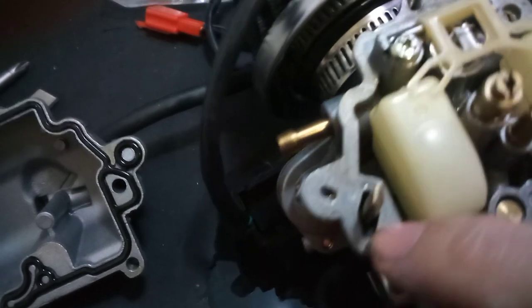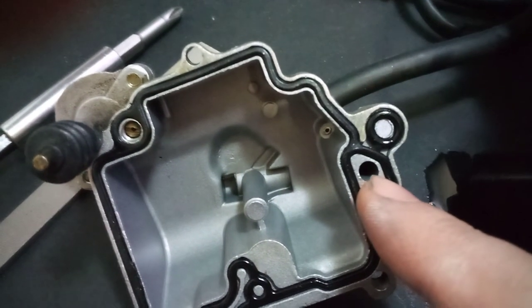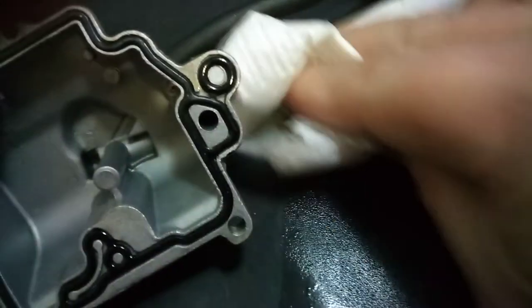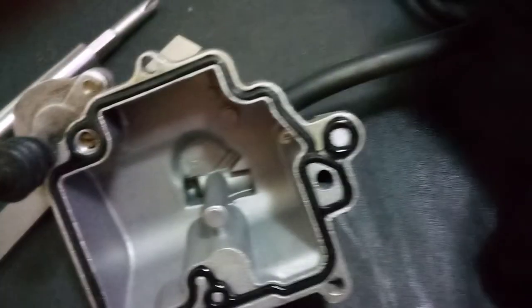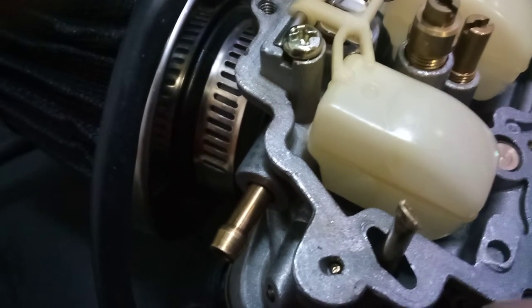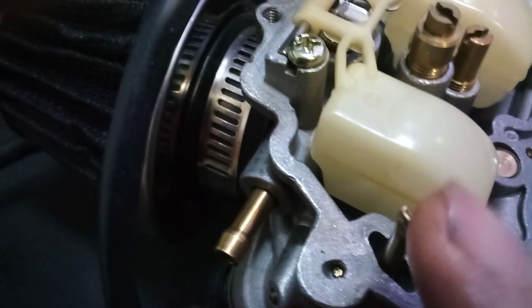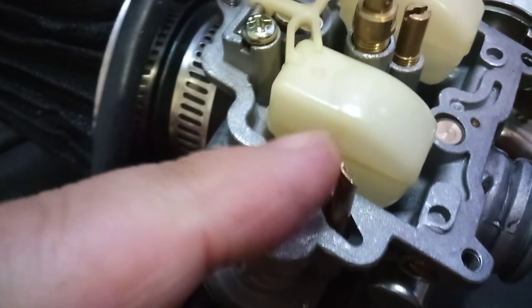You also have to think a step ahead. As you can see, I pinched this in the direction of the base — see that hole down there at the base, it fits right here in this hole. So if this does get too wide for that hole after filing, you just take a file and file off the sides — not the top part, because that'll increase the hole size, but just the sides — until it slides in. I'm at about 2100 RPM after three weeks and I'm thinking about filing it.